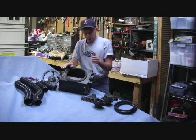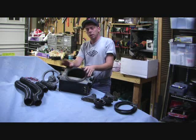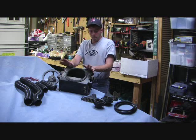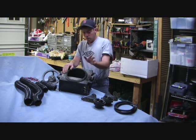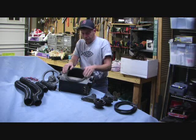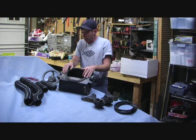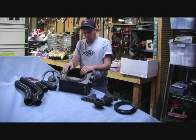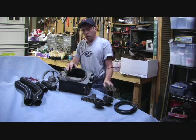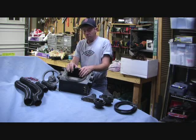Once you get the heater box apart and have cleaned up all the parts, make sure nothing needs to be sandblasted, painted, or otherwise retreated. You can then reassemble it, making sure the radiator is in the correct place, and feed it in through the firewall. It's simply a matter of also having the blower motor in place, and then once you get your dash, hook up your tubing and your vents — and you should be pretty well good to go.